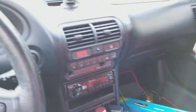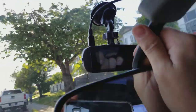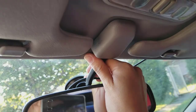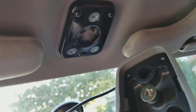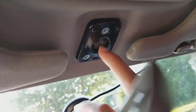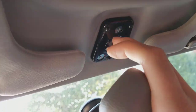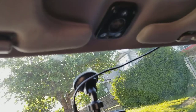So I just got home and we're starting to install the mirror. First thing first is we have to take the old mirror off. The way to do that on the Integra is actually instead of trying to battle and take off this plastic trim piece here, all you really have to do is pull on the whole thing. There's actually a little clip plate here which is what holds that little screw there in the middle in place. So then you can just take everything off, take these screws off and then take the whole thing off. If you want to put the OEM mirror back on, you have to put the clip plate onto the screw first, take the plastic piece off, put the clip plate back on the screw, put the brace back on, and then put the whole mirror and last plastic piece on.